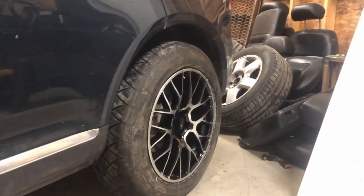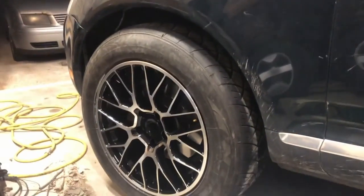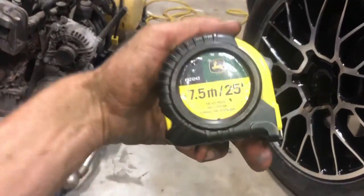I've got the tires on all four sides now. The back has no issues, but the front has issues with the support and the intercooler when turning. This car has actually been lowered already using this method prior to me getting it, so I'm going to set it back to factory ride height and adjust from there. During calibration you need to use a metric tape measure and measure from the center of your hub height to the highest point of your wheel arch.